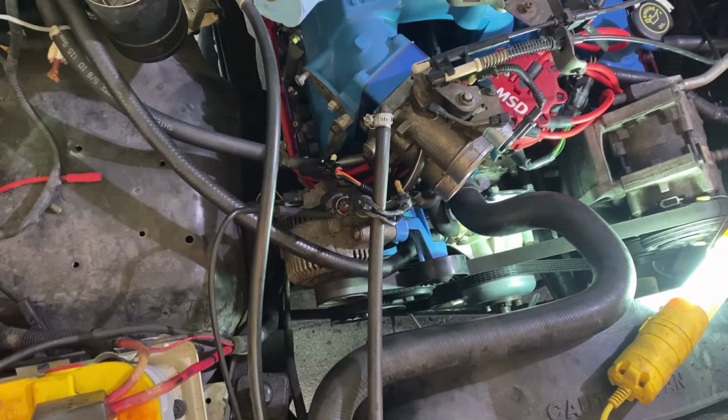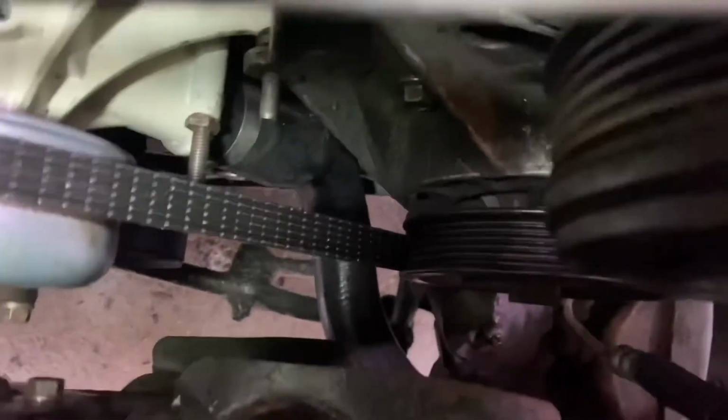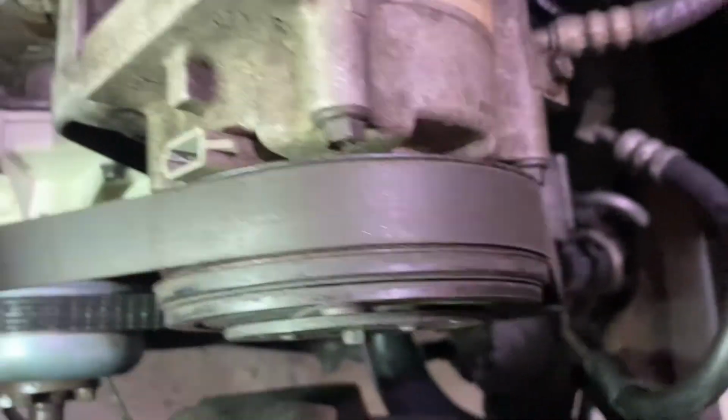Release. So on these belts here, make sure it's actually going in all the way, and the belt is centered between the inside and outside, and it's not setting up on one of those. So anyway, you can see how that goes. Maybe it's pretty hard to see really. So it wraps around the outside of those two, goes across under your idler, over your alternator, around your tensioner, down there through your air pump pulley, wraps around your crankshaft, comes back, goes over the top of your water pump pulley, and then goes down to the power steering pump.